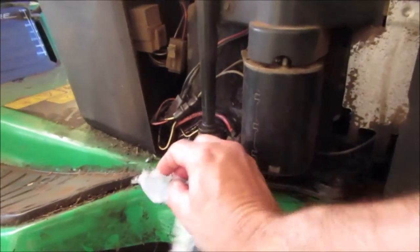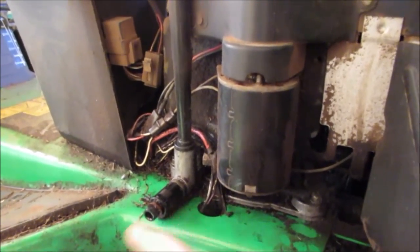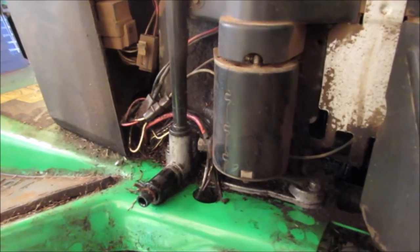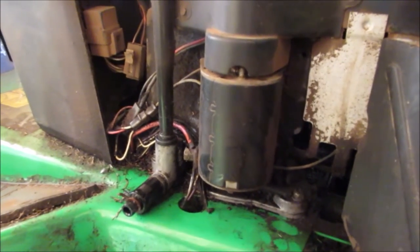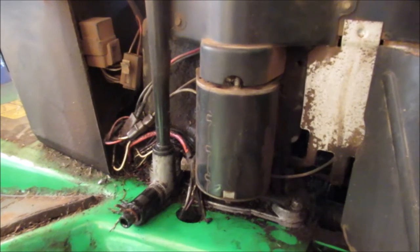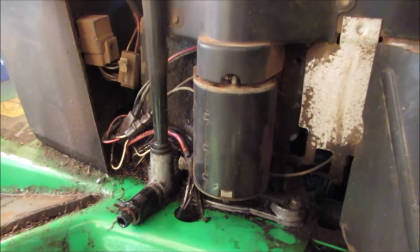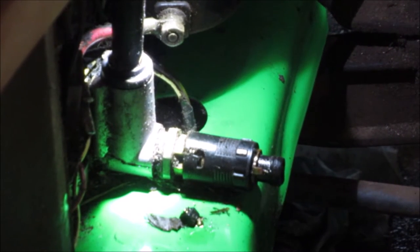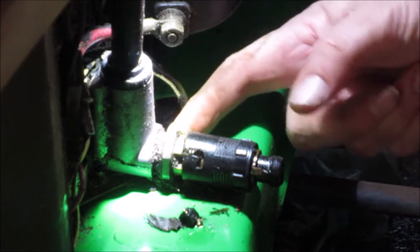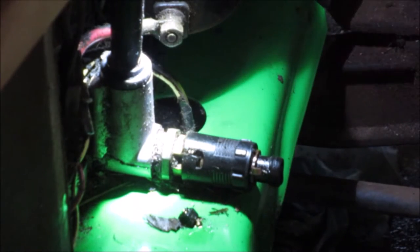I really think it's coming out the end here. What I might do is grab an oil pan and drain whatever oil is left in it. Looking at how much is on the floor I don't think there can be too much, but we'll drain that oil and then look at pulling this off and see if we can work out how it works and if there's a seal that's let go. It seems to have just about stopped dripping now, so it looks like there's this big nut — for a better term — we should just put a spanner on that and undo it.